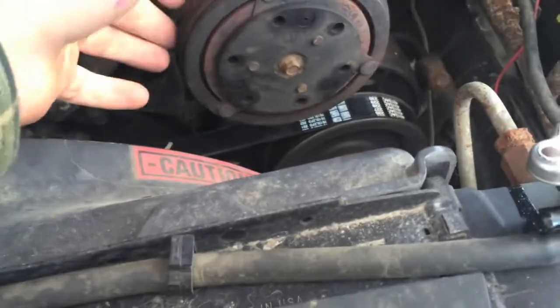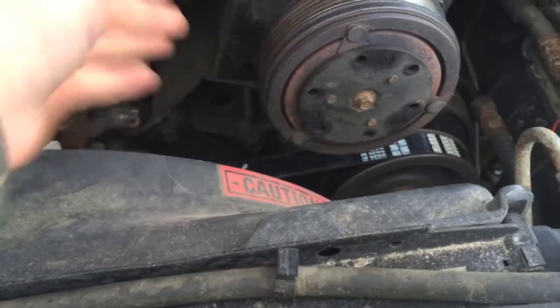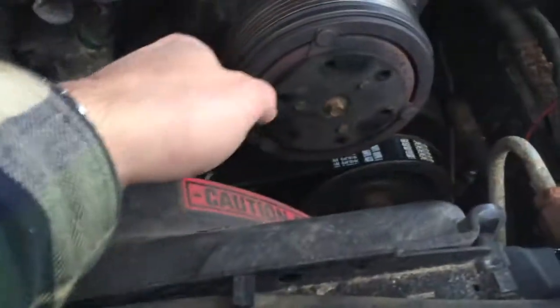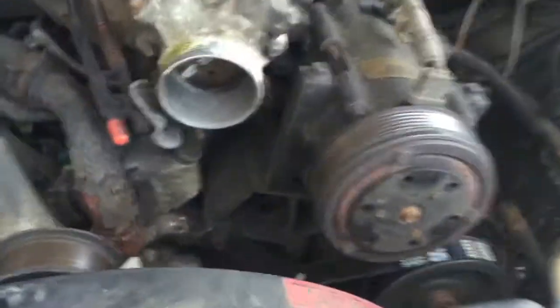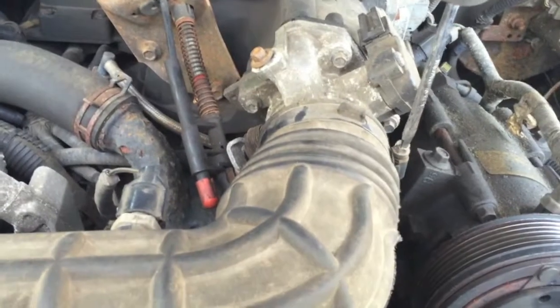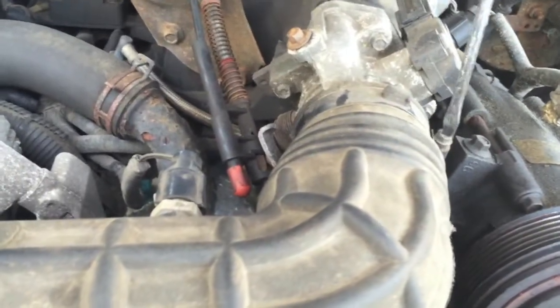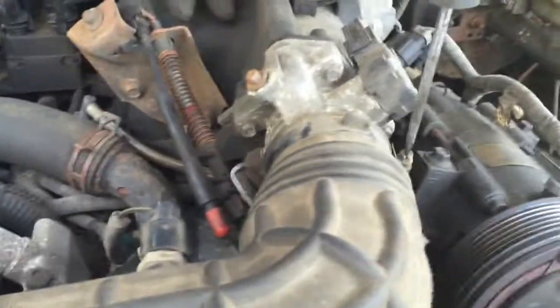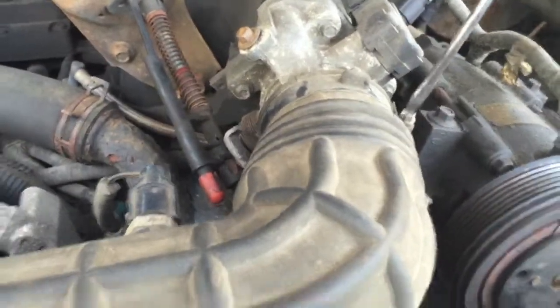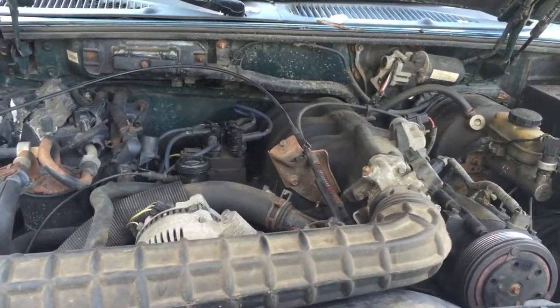And there's the AC bypass. The clutch is gone - I don't know why it was smoking, it spins freely. I'll put the air intake back on now, simply just shut it around there. Tighten it back down. And yes, that should yield us some extra horsepower - not really. Sometimes people do AC deletes on high-powered cars to gain a little more horsepower, but probably not much gained here. So now we're just going to start it up and make sure it works.